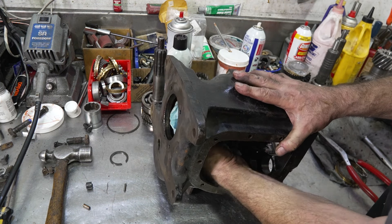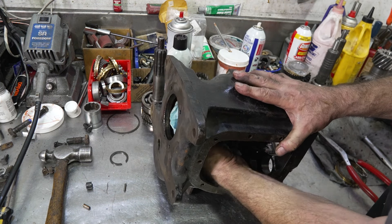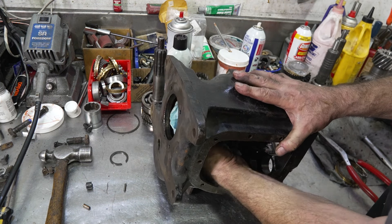Alright, here I want to show you the breakage of the gear - look at that, see that missing teeth. It's amazing because the gears themselves were actually worn pretty nice, but over the years fatigue and just hammering the transmission - this is what will happen. You've got broken gears. These gears are actually not available - you have to try to find some new old stock counter gears if you wanted to fix this box up. But I'm going to convert it all to late model Super T10 stuff. Here's the difference - this is what the Super T10 gear is going to look like. The tooth profiles are a little bit wider but the teeth are much more beefy.